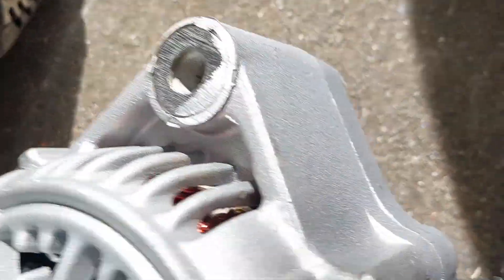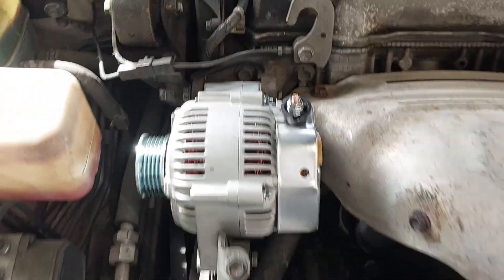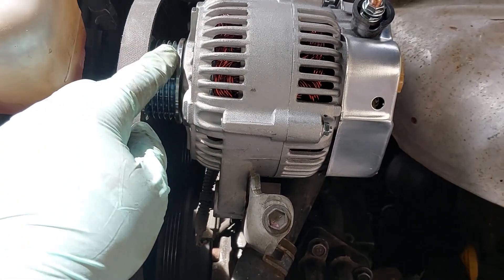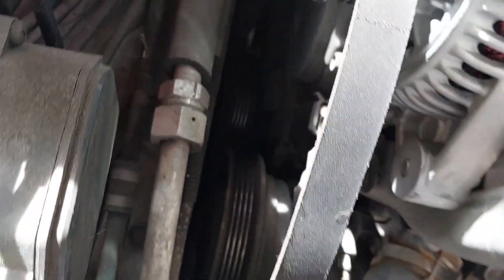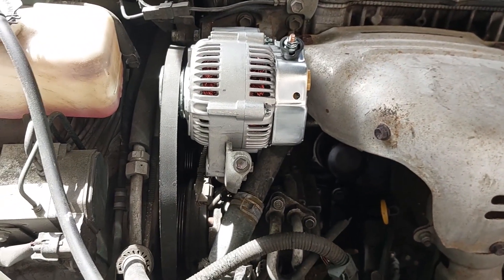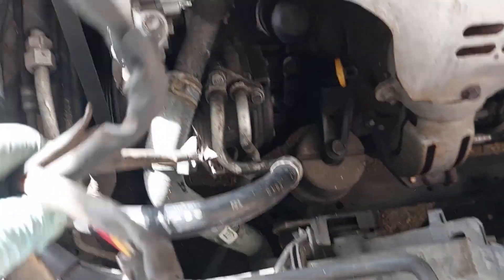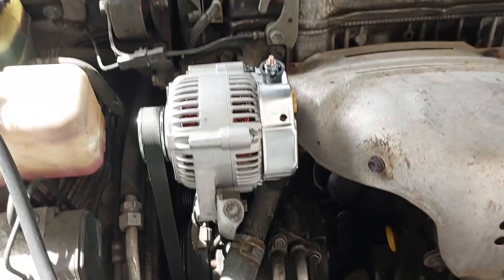With a little bit of grinding on both the front and back side, it fits perfectly now. So we'll go ahead and get this thing slapped in. With the bolts just finger tight, I'm still able to move it up and down — no problem. Go ahead and get the belt back on. Since this is a slightly bigger pulley, make sure to get everything threaded back on the air conditioning pump and also the crank down there, get everything aligned back up, then tension up the belt. Belts back on — took a quick second to get the alignment right, nice and tensioned. We'll get the electrical components back on and use these nice new bolts, then get everything plugged back up. After that, we're ready to turn it on and test it out.